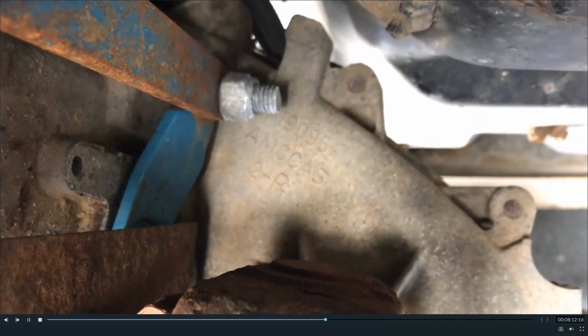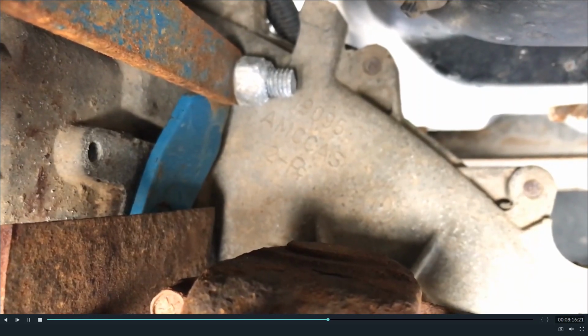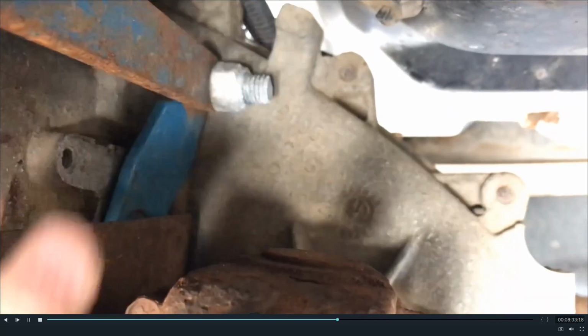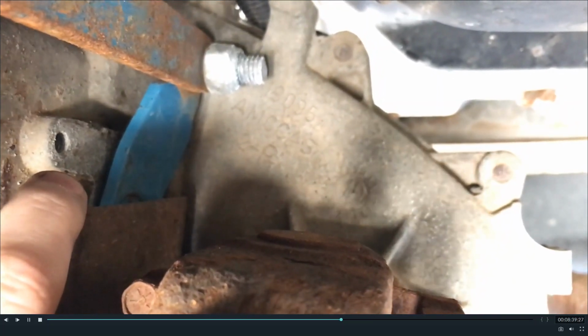And you don't want that to be a press fit, because the detent itself, or the shaft this goes onto, can move into the transfer case some. And that's what happened the first time, where we went to hammer it on more like a press fit, and it was not happy about it. There's an O-ring that seals the oil in there, and we, for lack of better words, messed it up.